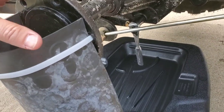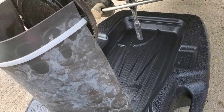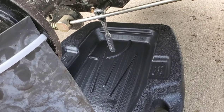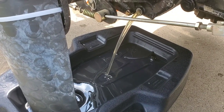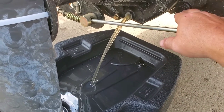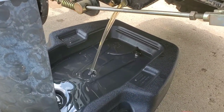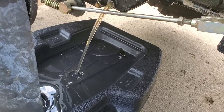I also went ahead and zip tied a piece of rubber on the end here where the wheel hub is so that if it comes out a little too forcefully it's not going to overshoot the drip pan. So I'll go ahead and get that drained and we'll be right back. And we've got that draining real nice now. It's going to take a few minutes to empty all the way out and you want to make sure that it's good and empty before you pull the filter, so you don't have an enormous amount of fluid coming out of that area as well.